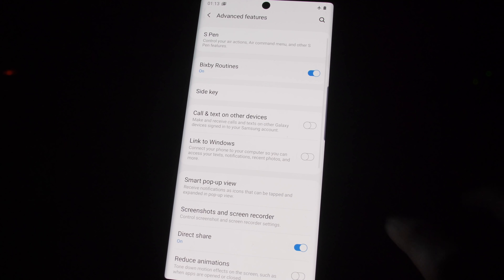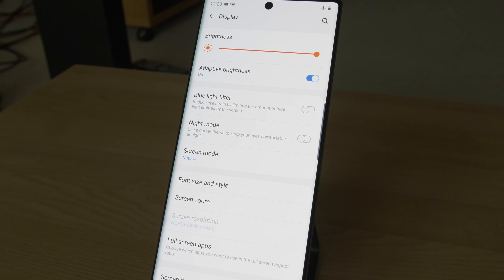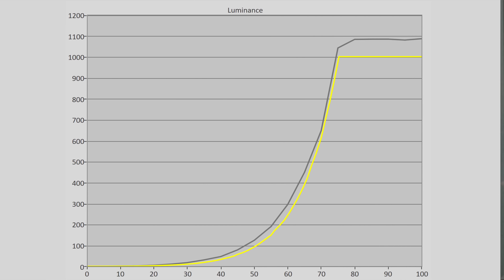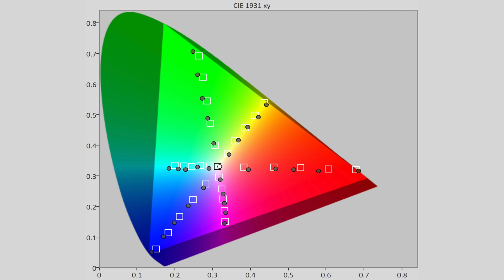There is also a little-known video enhancer function which didn't make any difference in our test pattern measurements. For HDR, the Samsung Note 10 Plus uses a separate picture output that's independent of screen mode or blue light filter, although it's necessary to crank brightness up to max for the highest peak luminance. Using HDR10 test patterns from Diversified Video Solutions, we measured almost 1100 nits on a 10% window, higher than the 880 nits obtained from the iPhone 11 Pro Max. However, PQ/EOTF tracked brighter than the ST 2084 standard, and DCI-P3 color points within a Rec. 2020 container were also somewhat oversaturated.